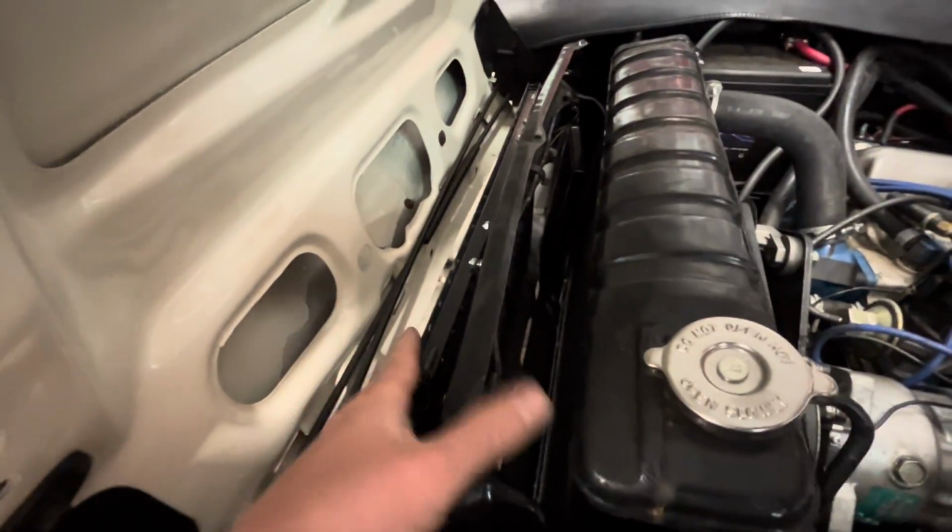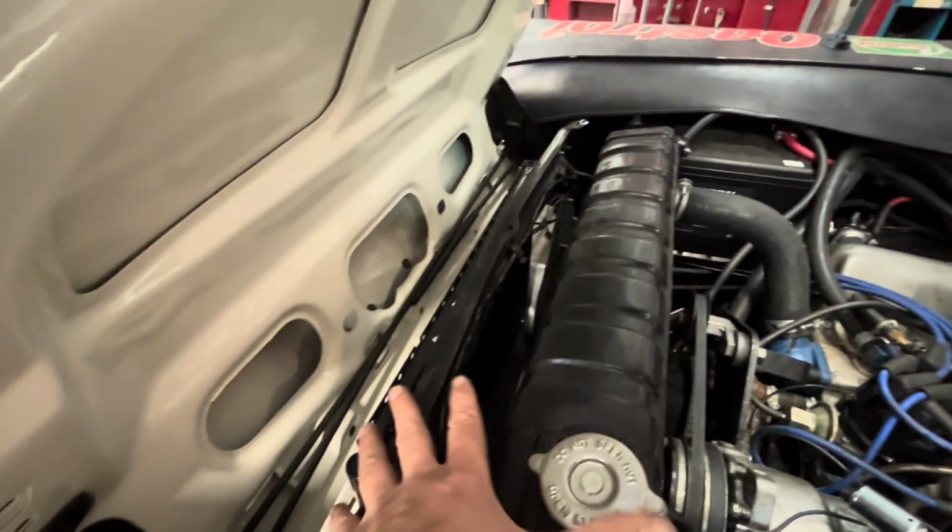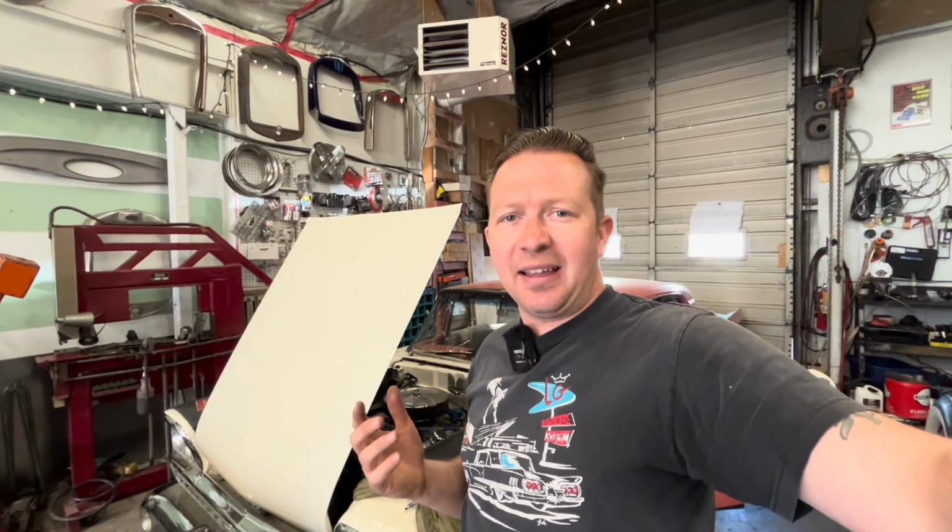There is a little bit of a distance between here and the radiator. I don't know if that'll be an issue or not. It's one of those you'll have to try it and see situations. Sometimes, if it's really, really hot out and you're sitting at a long red light, there's not enough airflow going through the condenser to cool it down, and your air conditioning might start blowing not as cold as it was. Once you start moving and the airflow goes through it, it'll cool back down again.